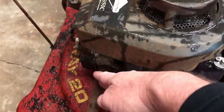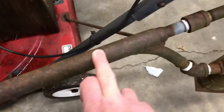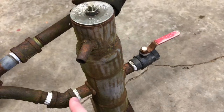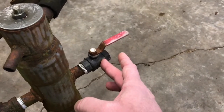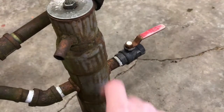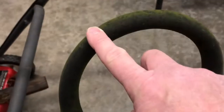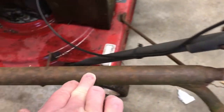Let's talk about the exhaust. Here's the exhaust — notice that the exhaust comes up here and it goes through the fuel plasma reactor also. Ain't that interesting? And then it ports out right here. This is another little added device — it's actually a cylinder within a cylinder. The exhaust can pass around the center cylinder. Here's another ball valve to where I could control back pressure on the engine. I had motor oil inside here, and my thought process was to heat the motor oil up enough to turn it into a vapor so it could be drawn into our intake source, regulated with a ball valve, and we could actually burn some raw used motor oil back through our fuel plasma reactor.